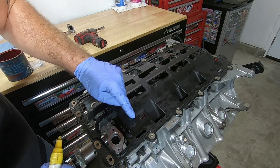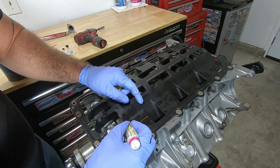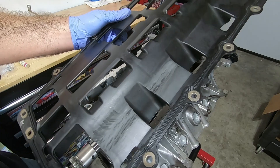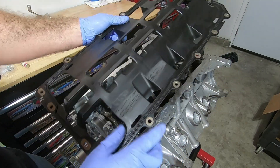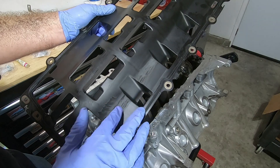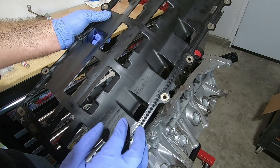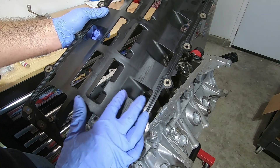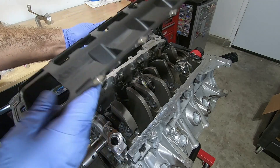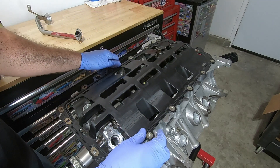Now I've got a little imprint from the grease — I'm just going to go around that with my paint pen. Here's what I hope to be the finished product. I've done this a few times. I'm trying not to go through it, but even if I did, it'd be okay — like if I made two square holes right here, that'd be fine. It wouldn't affect the windage tray structurally. I'm going to put this on and see how it fits.